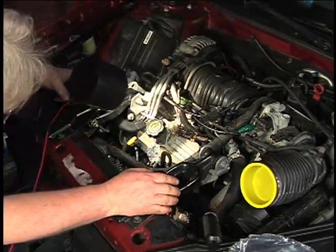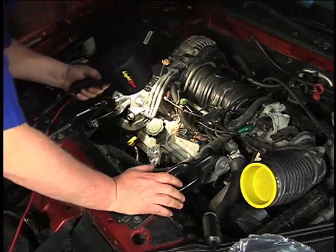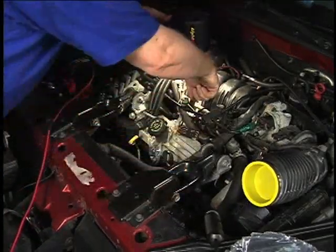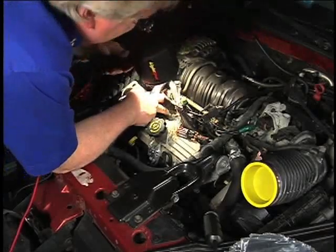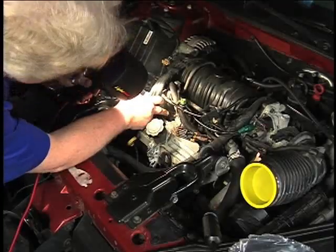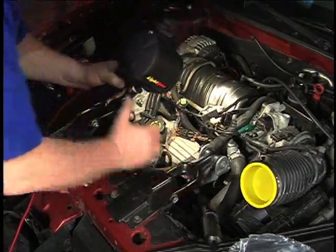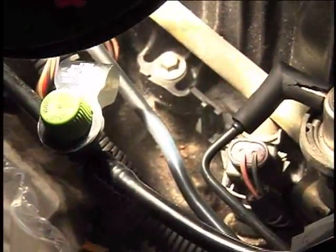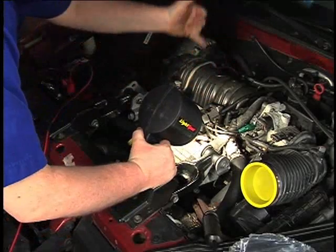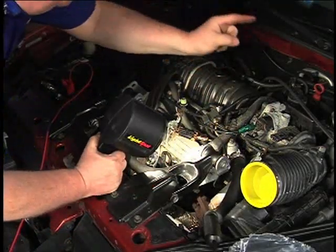Oh man, I've got a leak. Something serious here. I've got an intake manifold leaking straight out from an intake manifold gasket, and I've got an injector — looks like number two injector is leaking around the o-rings. And I have a little bit of a leak — and I've got a split right here too. It was holding when the other leaks were leaking, but now it's leaking a little bit around the split. So we definitely need a boot, injector o-rings, intake manifold gasket, a fitting on the intake, and a new valve cover. We've got some work to do here. We've got a good sale too. But we had a lot of leaks and in fact it became difficult to get the camera in there to see the injector leak.